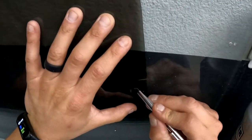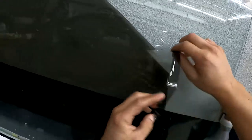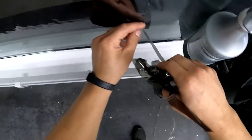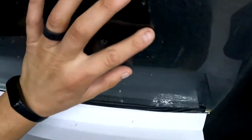They're pretty expensive, but not as expensive as Graphtec and stuff. And they work great. They get the job done. Very easy to use. Just takes time to understand the machine and how to adjust and stuff. But once you get that down, you'll be okay. Make sure you guys are buying the high-end blades. That could be a big issue with plotters. If you're using cheap blades, you can run into some issues cutting ceramic film or more harder-to-cut material.